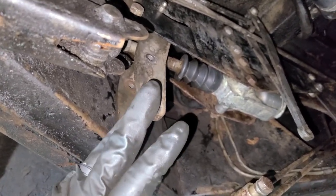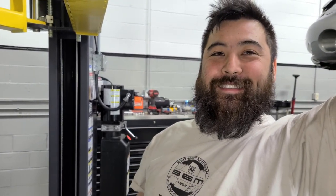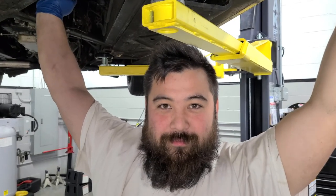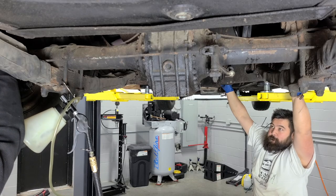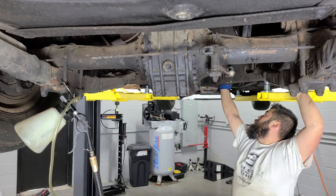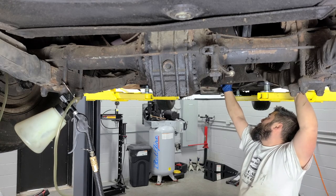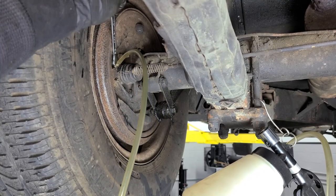I have Peter. He's a fine English gentleman — he's going to be my brake applicator guy. You are 100% English? Yes. No one else can work on this. So right now the bleeder is closed. I'm going to open the bleeder now — go ahead and push. And then I'll close it, and he'll go back. He can't go back until I'm all the way closed, otherwise we're just going to suck air right back in. Open, go ahead, all the way down. It's coming. And we'll close. The important part here is we don't have any air bubbles. Fluid is definitely moving. Let's do one more for good measure.